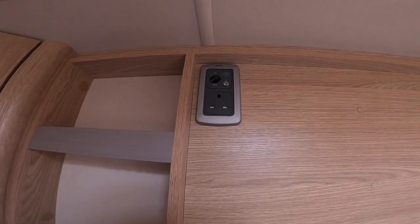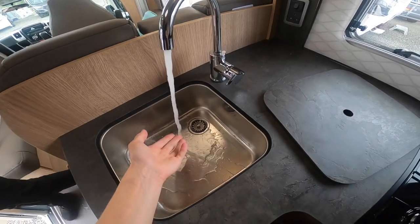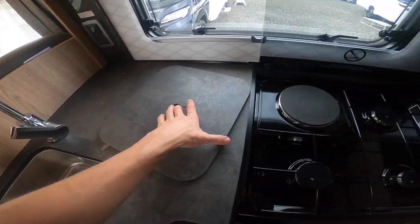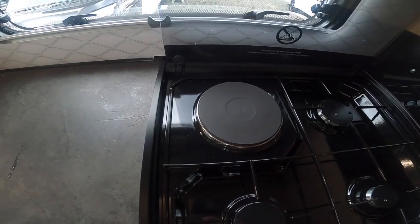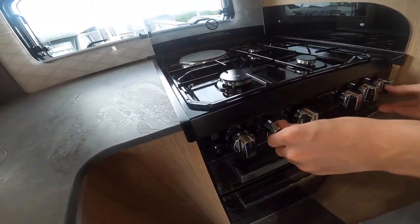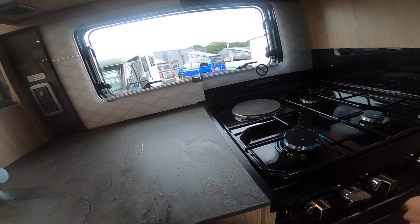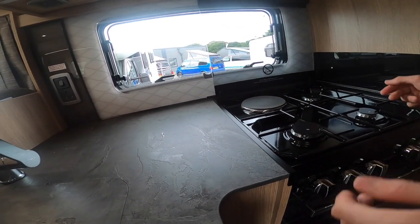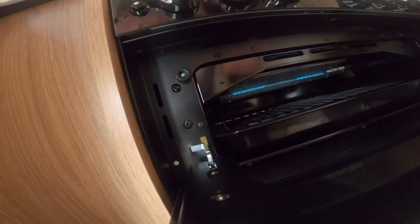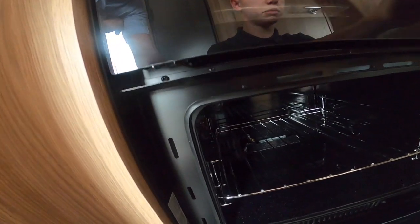Now in the kitchen you've got your kitchen sink — that's showing the water pump's working and the water's getting up to temperature, coming through nice and warm. On the hob you've got one electric hot plate at the back operated by this switch, and then three gas burners. Always allow everything to cool down on gas before you put the cooker hood down, and the same with electric — you don't want the heat to smash the cooker hood. Below you've got your grill — you may want to take your grill pan and oven shelf out when travelling, or wrap them up.